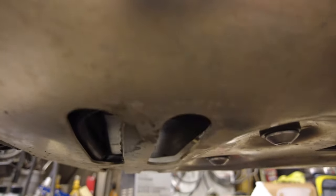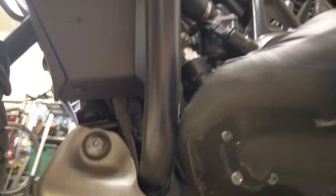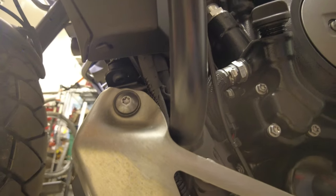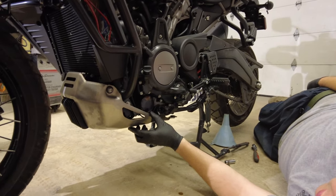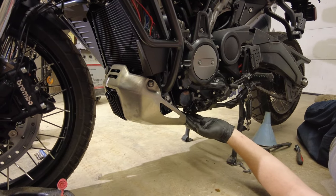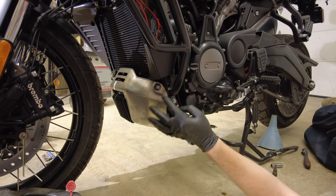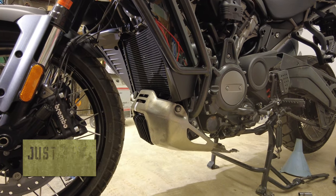Get on the ground and come down here — you're going to see the old skid plate. There are four bolts: one, two, three, and four. Also, there are two bolts on the side of the skid plate — one on this side and one on the opposite. We're going to loosen those up to allow the skid plate to pivot down. Once you have the skid plate loose, gently allow it to tip down this way, and this will give you good access to your oil filter. You could remove those two bolts and remove the skid plate totally, but we don't really need to do that.